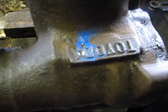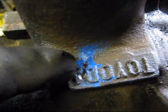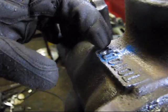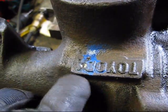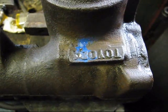Okay, I just started drilling and I realized something. That is way too close to that edge there, so I moved the drill point to right there, because that's actually more in line with that groove in the box where it kind of tapers up at the high point. That was way too close, because once I drilled up to the full size and then tapped it, there would be just a hair left there, so I'm glad I stopped when I did. I'll just finish drilling her.